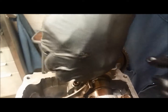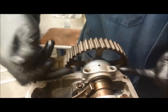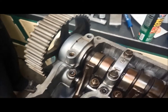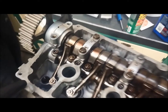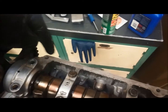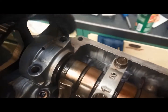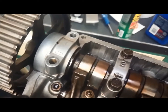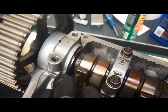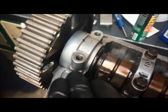When we put that on there and torque it down, it'll make sure the oil can't seep out between those two halves, and it will seal it. The reason it's so important to put the silicone in there is because now we'll put the valve cover gasket on this — the valve cover gasket will wrap over the top of that, and over here. We'll put a little bit of silicone as well when we put the valve cover gasket on, right in that corner and right in this corner, to keep it from leaking there in the corners. Because the gasket wraps around it, there's nothing besides that sealant that would otherwise prevent the oil from leaking out around that.